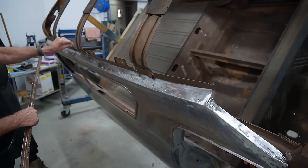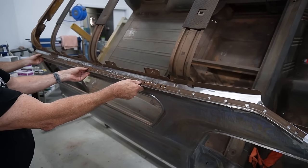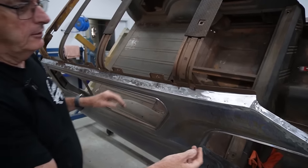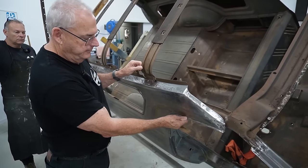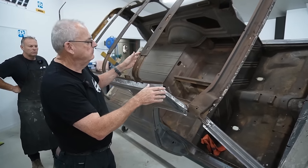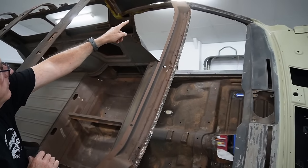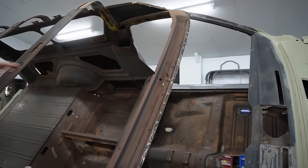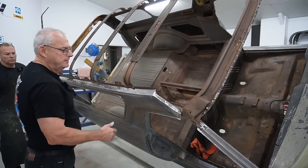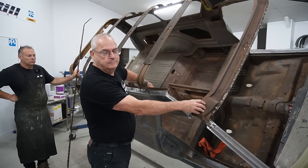But as you can tell here, once you start taking the double panel sides of things out of it, so we remove that which would add strength, and then once the roof goes on, that's what creates the strength in the car, because it's quite interesting when you look at things like this that none of this is attached to anything. And the reason for that is the body shell on a van is effectively a ute shell with a bit added on. And if you look up the top there, this is the windscreen opening, is the same as a ute. And then that's the top of the ute, and then it goes back down and along, and they've just added on this section to make the panel van. So this bit here is the panel van. If it was a ute, it would be down through here. So I have no concerns about it being in the rotisserie with the roof off it, because the structure of the ute is all still in place.